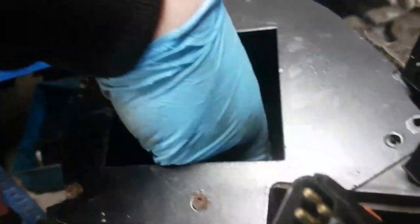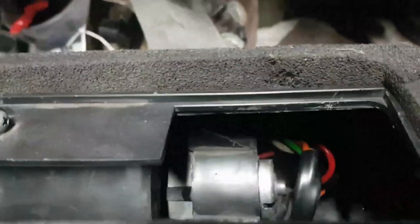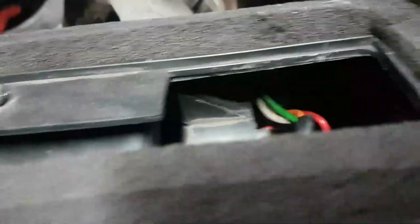Now what I'm basically looking at in here, let's put it in the same location so we can look inside. You can't see. Let's take this end plate off like I've done the other one. Right, so in here, can you see how much I'm pushing that fan backwards and forwards? When it's in its most forward place, it's touching the edge. When I push it right in, it's fine. Here, you can see the end of the motor. Now, if I go back down again and push the fan, you can see the whole armature is moving backwards and forwards. So there's something gone wrong with this motor as well.